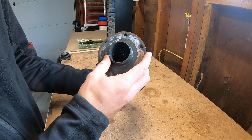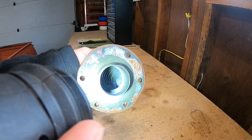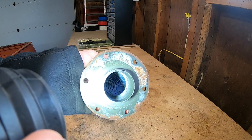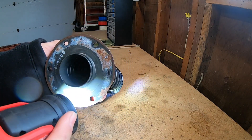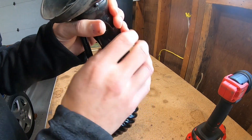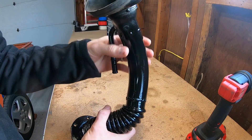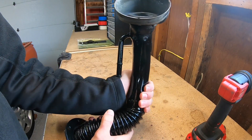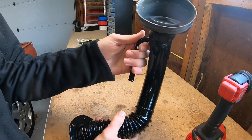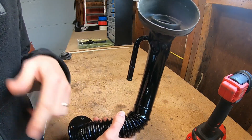The reason I say not to do this — if you look in there there's a coating inside, like a plated or zinc coated steel tube. When I welded through there I burnt off all that coating, so the chances of this thing rusting increases. But it's going to be inside of a sealed fuel neck, and given the life of this vehicle I highly doubt this piece rusts out or causes significant problems. I have a fuel sock and a fuel filter so I'm not too worried about it. I don't suggest doing this, but I did it.